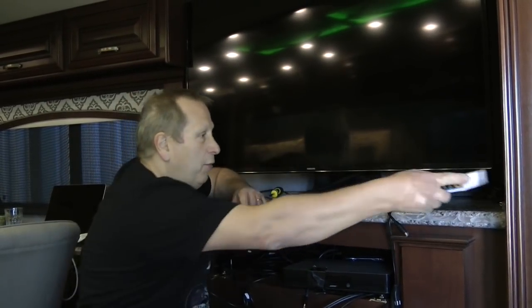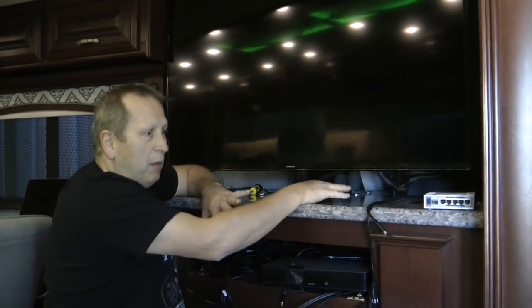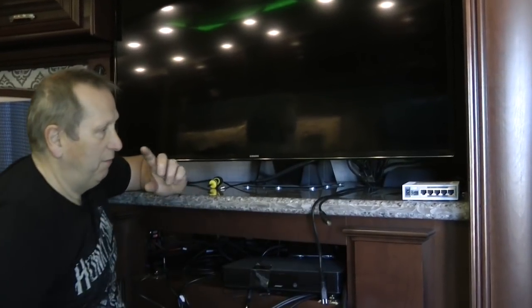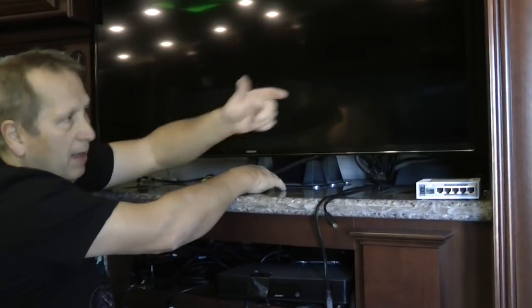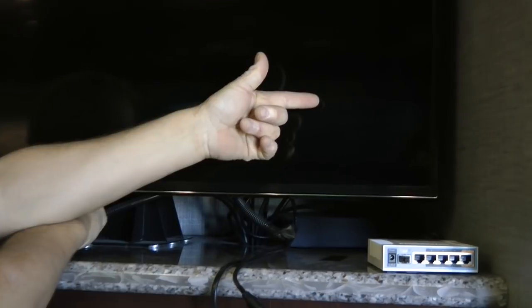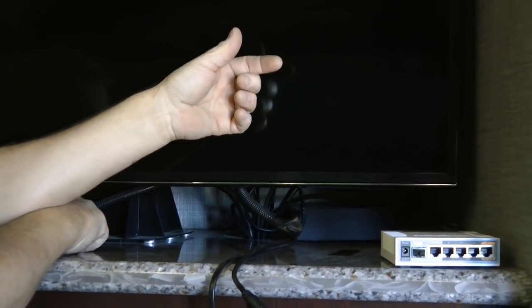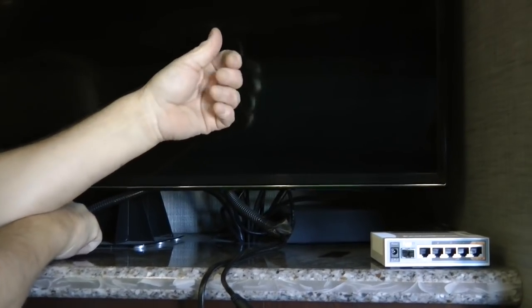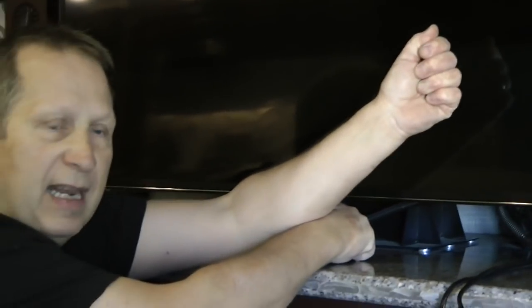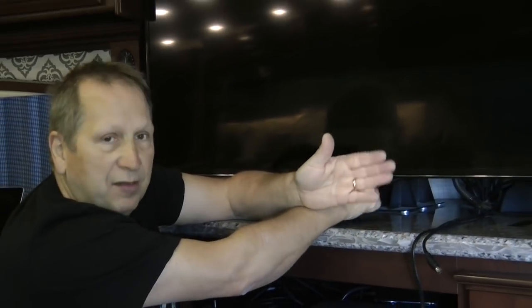So the first thing we need to do is actually remove the TV. Take the sound bar off. There's just plug in and pull out plugs, but very, very important on this. On this side of the TV, there is a coax cable at the back that has about 1/8 of an inch play. And if you're not careful, you'll unscrew all the screws, and then you still won't be able to get the telly out. And what you're actually doing is bending the RF card inside the TV.